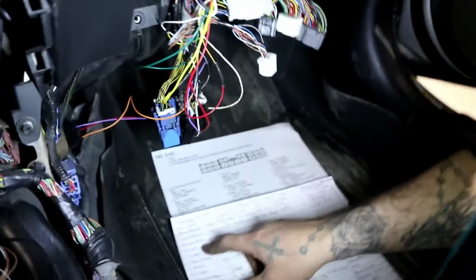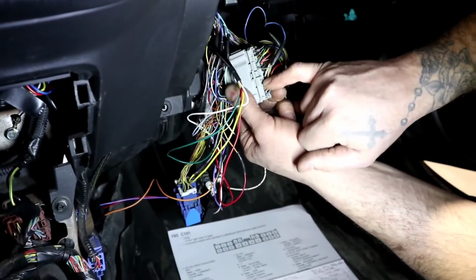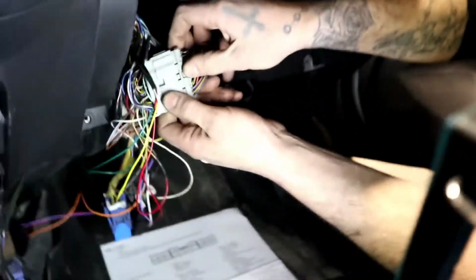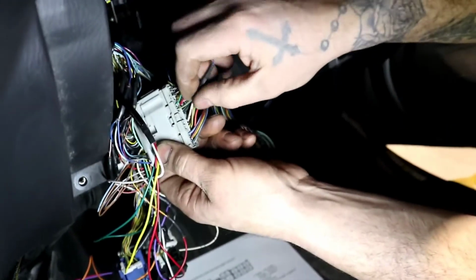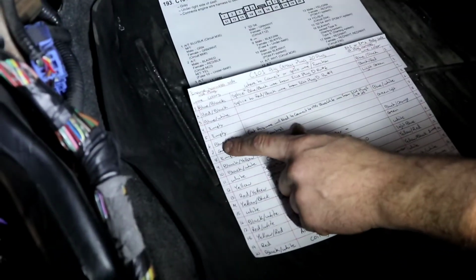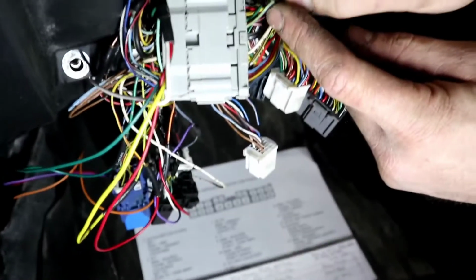All right, let's go to number 4. Number 4, it's empty. And that's exactly what we have. Number 4, empty. Number 5 next to it, empty. Number 6, the one over the plug release. So number 6 on the engine harness side is going to be a blue-yellow wire, which we have.